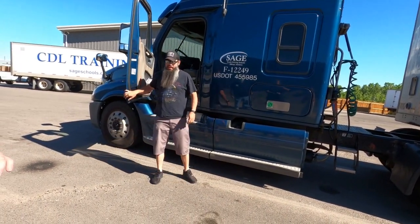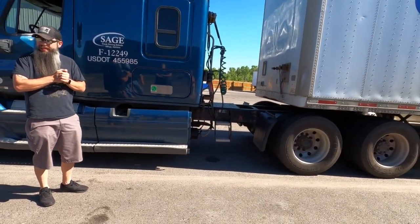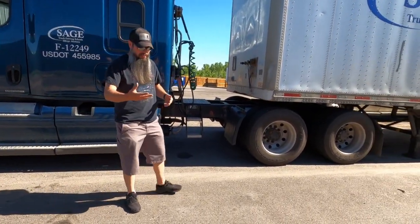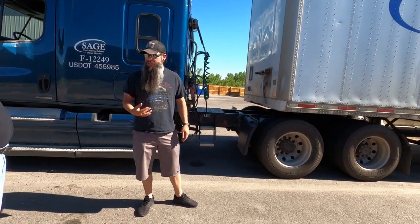There after I hooked up, went ahead and did that tug test to make sure that she seated it. You saw it and heard it click in and everything like that. Now, don't just trust that. At this point, we need to check everything, okay? So the first thing when we're hooking up, just like we had LAF, now we're going to do FAL, right? So fifth wheel is my first check, okay?